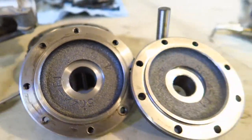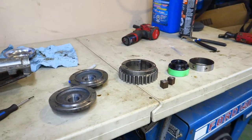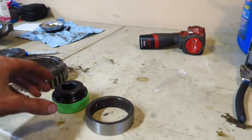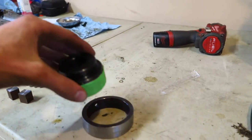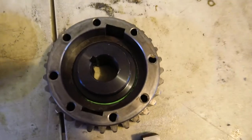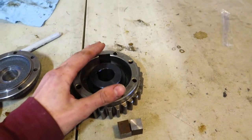There's the difference — machined one inch hole versus machined seven-eighths hole. After some machining, drilling, sweating, and some tearing, we got some parts. I found this machinist lock ring, took off a few thousandths off the outside layer, and now I have my locking hub. The ID was bigger than the OD so I've got some tape here to get it a snug fit, and with the machined piece it can fit in there nice and snug, leaving us with a spinning hub not yet welded — I'm going to weld that full assembly and the locking collar.